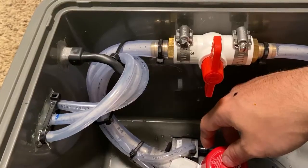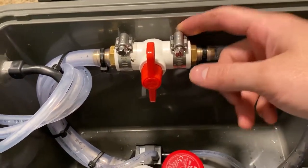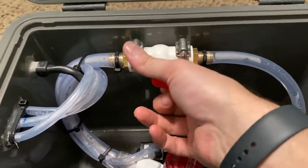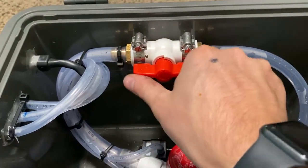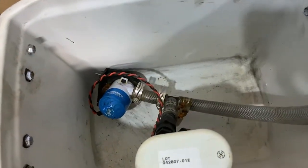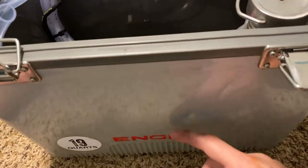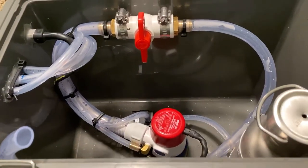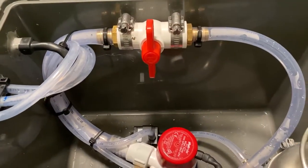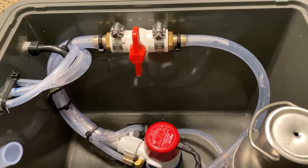Pretty easy to get this thing apart. The rivets through the clamps was a really good idea — it's tied down very tight and doesn't rattle around like the old one, which would try to pull the pump off its mounts and rip it through the side of the plastic. If you rip this pump out, there are holes from the outer tub through the styrofoam and it'll fill with water — you don't want that. When you put your rivets in, make sure you seal them up well. They seal pretty well on their own but add some sealer just to be sure.